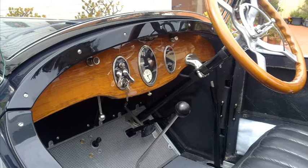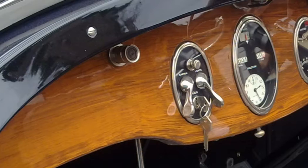I had to put Tassie Oak timber inside it. I knew what the shape was because the metal skin determined the shape. So then I had to put the Tassie Oak in, all mortise and tenon joints, like Packard used to do. Studebaker and Packard did mortise and tenon joints, and the cheaper models like English cars used halving joints, whereas quality stuff had the mortise and tenon. So all that had to be made and fitted, including door frames, so the new skin could go on the new door frame. And that was the timber work done.